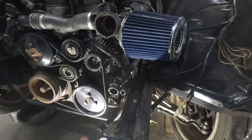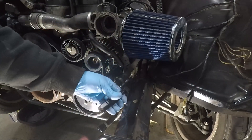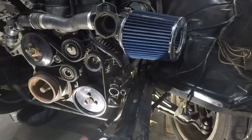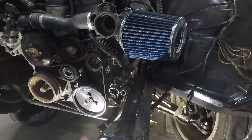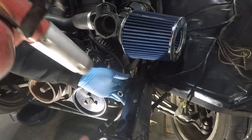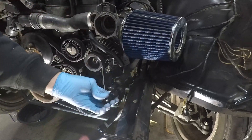I have pretty easy access to these lines, which is definitely gonna help. I went with Dash 8 fittings, which are half-inch OD. These lines are very close to that, so I'm gonna have to heat them up. I'm gonna heat them up with basically a glorified hair dryer, get them a little bit soft, and then slide these in using a little bit of lithium grease to help those fittings on there. Slide the barb right in — just like that, she's in.